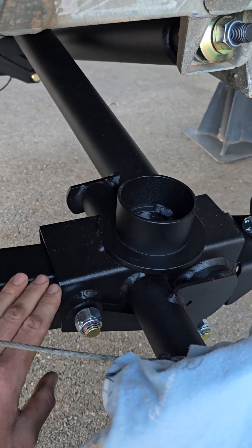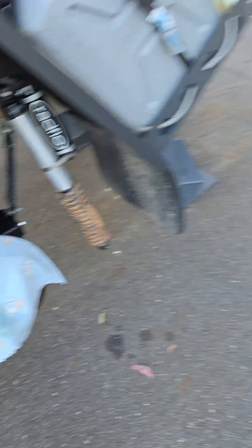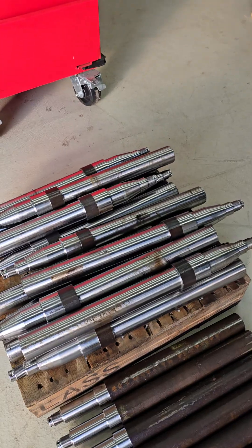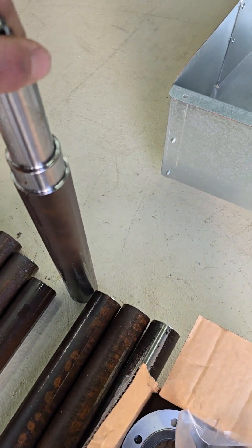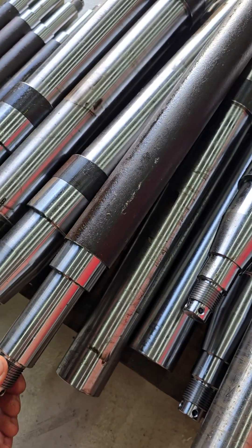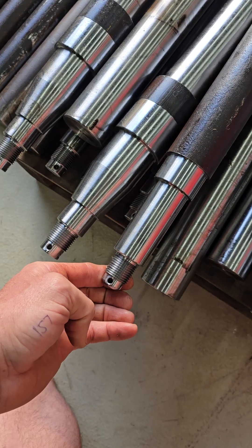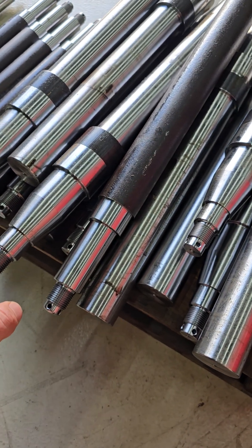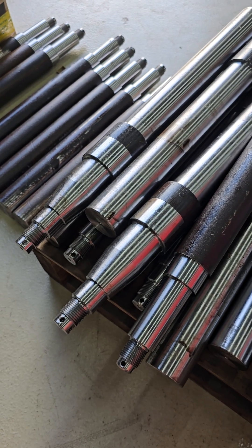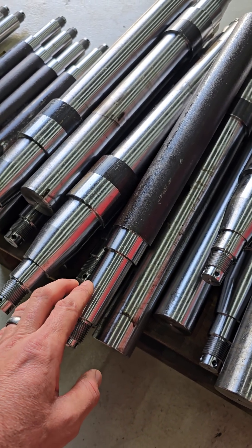This one is an airbag van — not the best example — but you can see it's a textured finish, very durable. We've had really good success with that. Over here, let's have a look at the stub axles. These are two-tonne as we discussed; these are parallel. We still use parallel for a good reason. Physically there's quite a bit of difference there — as dramatic as the difference is between those two inner bearings, the same is true for these stub axles. We prefer the two-tonne — it's a good bearing set. The 12-inch brake is a nice upgrade. It's certainly not necessary, but it's nice.